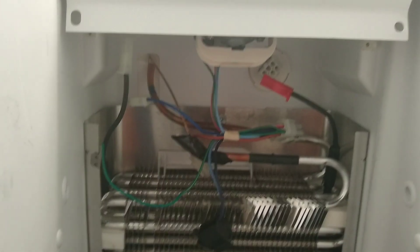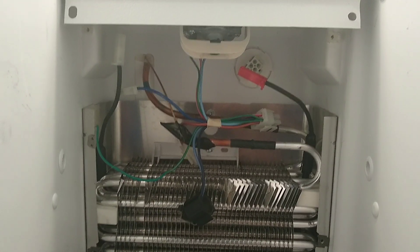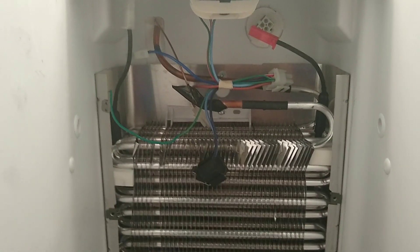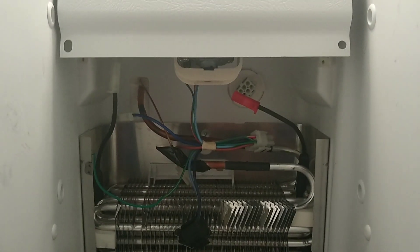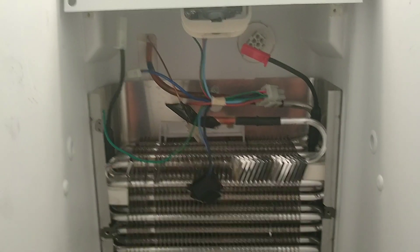I just want to go over the basics of what we're looking at here. This setup is your common basic refrigerator defrost setup. GE does have thermistors, and there are other models with thermistors — you can't test thermistors the same way, so a lot of times I just replace those too if we're having a defrost issue or if the refrigerator is running a lot. I just want to explain this part first and then we'll go into more in the next video series.